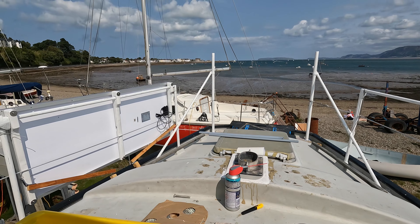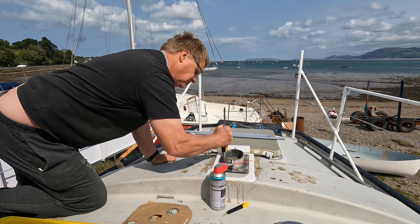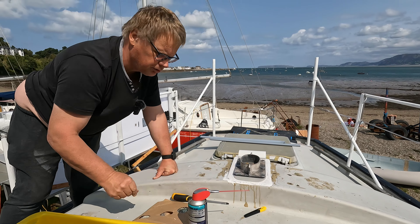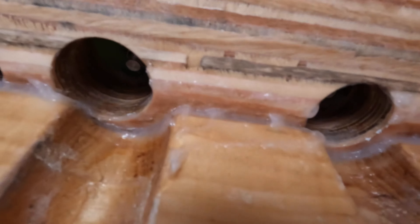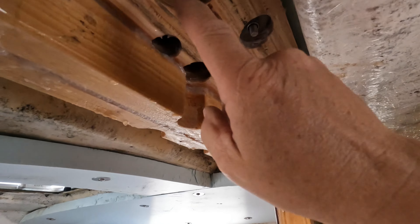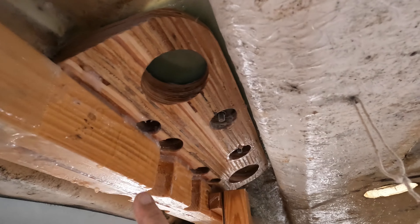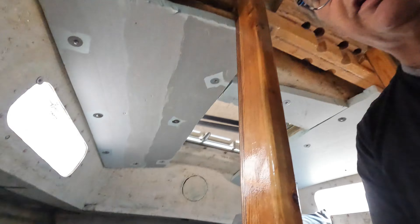I'll just have to get a hammer and knock that in. Jane's going to hold the screwdriver and I'm going to go and put the nuts on. There are bolts now done up. Six bolts, ten millimetre, nice big washers. Above this plywood there's actually an FR4 backing plate that completely covers the whole area — that's on thickened epoxy. So it's very, very, very strong.